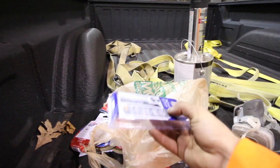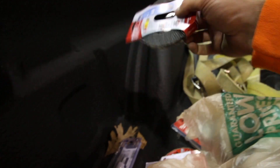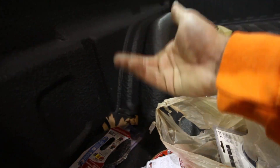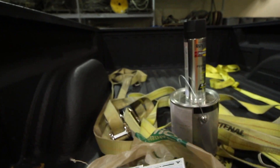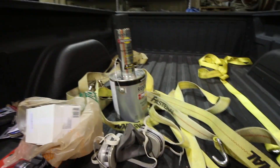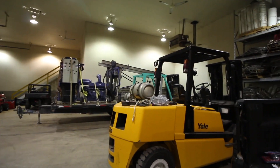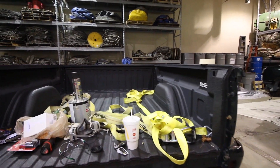For some of the crevices, I'm using just a little wire wheel brush. For my grinder itself, I'm going to use this 60-grit right here. I've also got another wire wheel — this stuff works pretty well, I find it a little bit easier to use. If you've got $30 to $50 to spend on parts, I'd go ahead and use that. Here's some filters for my respirator. I can't stress this enough, guys — use safety materials, especially when you're working with this many contaminants in the air. Safety glasses and your respirator. I'm also going to set up a fan to ventilate the garage. It's always super safe to take the measures you can to help yourself.